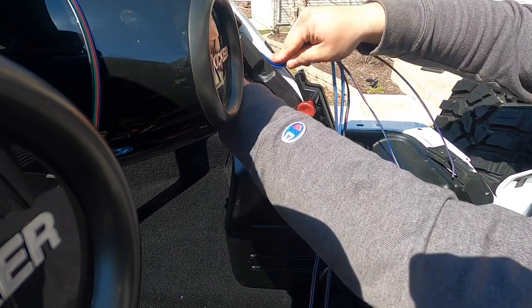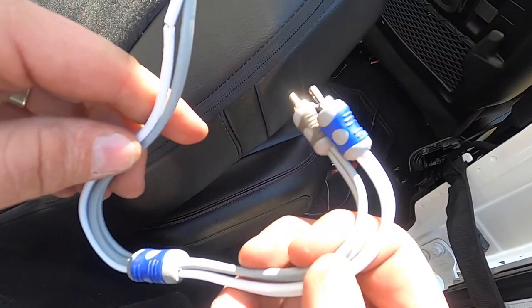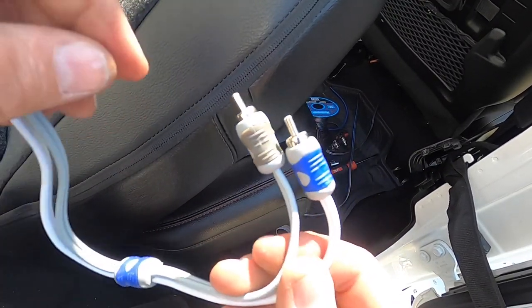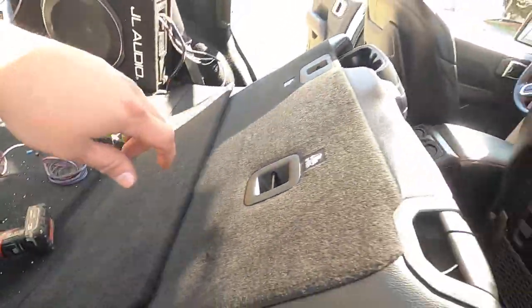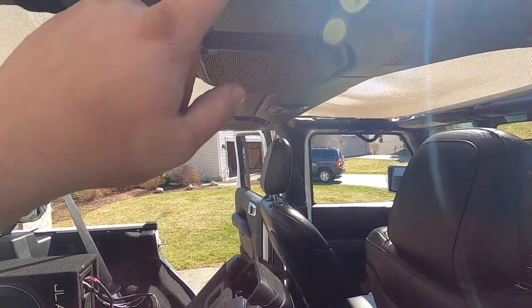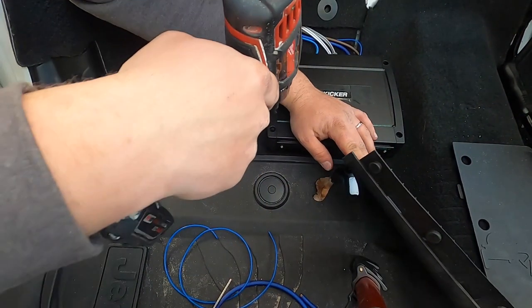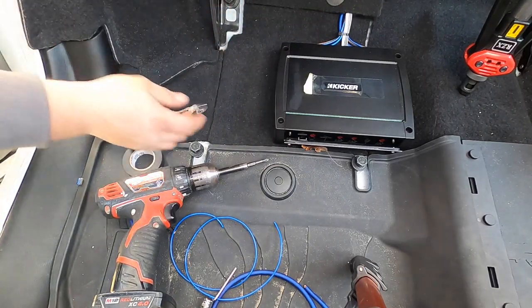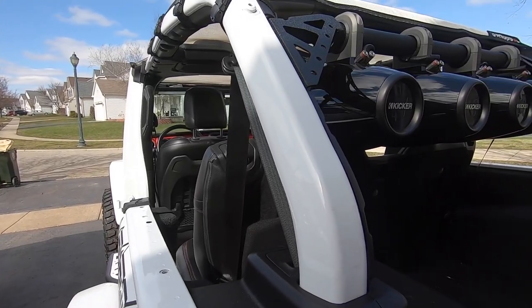Once the speakers and RGB LEDs were all wired up, I hid the wires through the pillar trim and underneath the carpet right to the amplifier. The Kicker amplifier allows you to connect high-level inputs directly to the RCAs using their KiSSL, which taps into your speaker wires. Since I already have an installed subwoofer tapped into the rear soundbar, I hooked up to those wires — but if you don't, you could hook up directly to the speaker wires from the rear soundbar. For the LED lighting I hooked it up to one of my existing RGB LED controllers, and I'll put a link in the description.